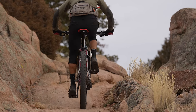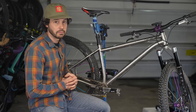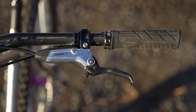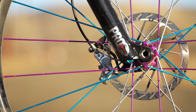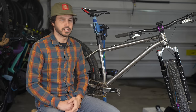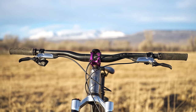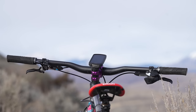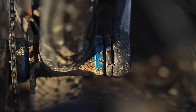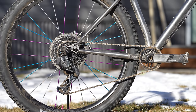I haven't experienced too many pedal strikes with the 64 millimeter bottom bracket drop, but I also adapt quickly to bikes in that regard. I really love this silver wear protector, which plays well with the theme of the build with the silver fork crown and these Level brakes. I haven't had the best experience with new brakes from SRAM, but the ULT Levels performed a little bit better than the others I've tested, although stopping power still does not live up to the TRP Trail Evos or Shimano XT brakes. Still, I love the shape — great for bikepacking. I also used the 50 millimeter Race Face stem, 800 millimeter Salsa Guide 35 millimeter bars with a 20 degree rise to dial in the reach. Other components include a Cane Creek 40 headset, Blue Wheels Manufacturing bottom bracket, a 30 tooth round Wolf Tooth chainring, and the first generation Axs Eagle drivetrain, which I've had since around 2019.